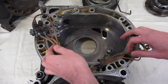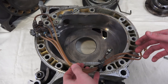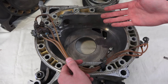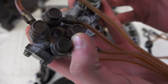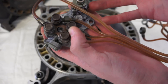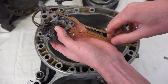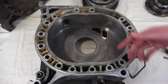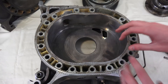That leads us to the third disadvantage: by design this engine is going to be burning oil because you're injecting oil directly into the combustion chamber. So periodically you're going to have to check the oil levels and make sure you're running a sufficient amount of oil. Here we have the oil pump which is actuated with the throttle — as you apply gas, it opens up a valve and injects more oil into the engine. There are four of these injecting directly into the housing and also into essentially the intake manifold where it mixes with the air and fuel mixture. Obviously if you're injecting oil directly into the combustion chamber, you're going to be burning it, and because of this you're also going to have worse emissions.